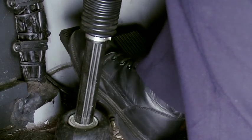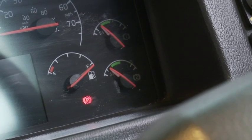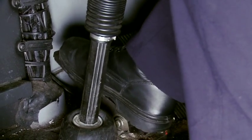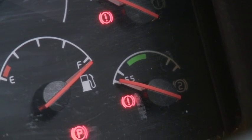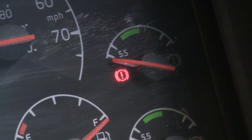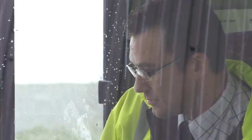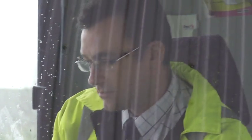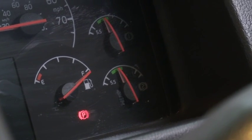To check the air gauges are functioning correctly, begin by repeatedly pressing the foot brake to deplete air from the air storage system. Listen for the low air warning buzzer, and look to see the warning lamp illuminates at about 4 bar, or in the red section on the air gauge. Then build up the pressure and listen for any leaks in the system. The air should stop building around 8 to 10 bar, or in the green section, depending on the vehicle.